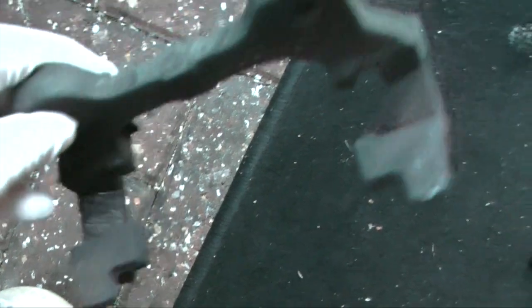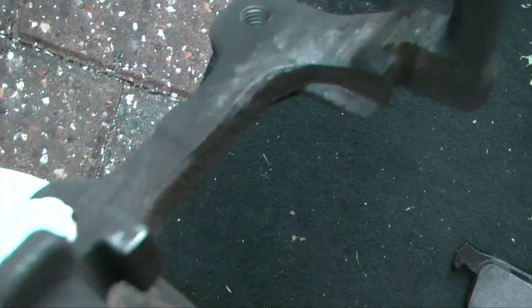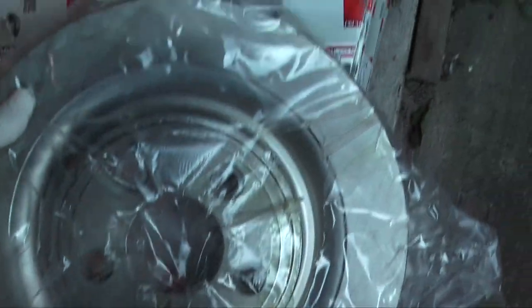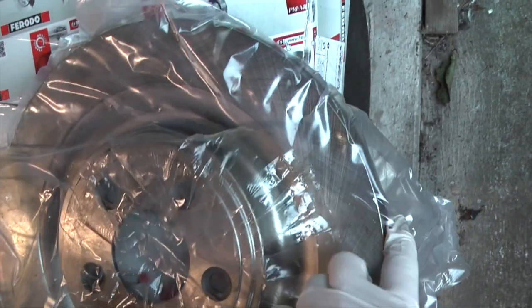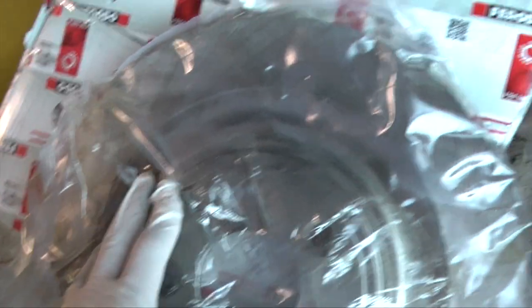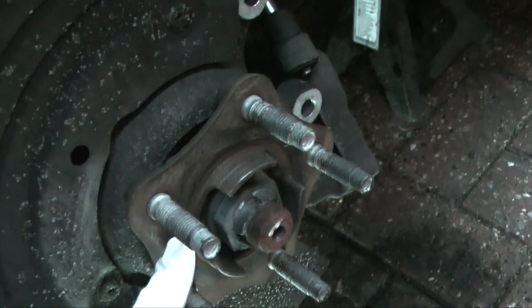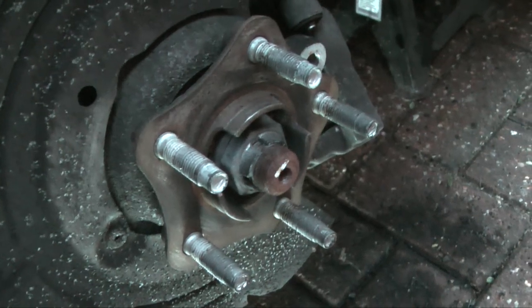When you've cleaned up your carrier it should be free of crud so the brake shoes can move freely — same with the caliper. When you get your new discs they come packaged in a greasy substance to prevent rusting — clean all that off or it will contaminate your pads. Get a decent brand; I used Ferodo discs which weren't particularly expensive. After cleaning, apply a little copper grease to the mating surface — not on the friction surfaces — so that next time you replace the disc it won't have spot-welded itself to the hub.